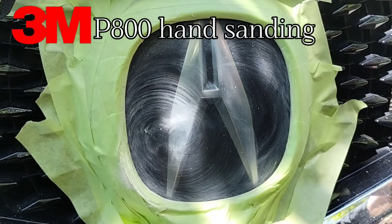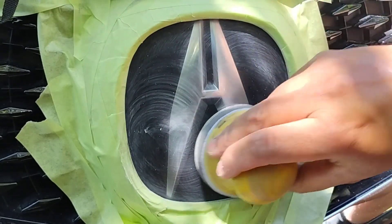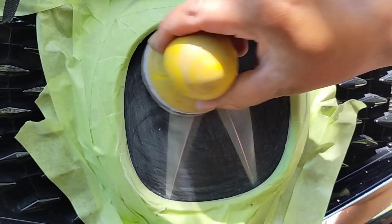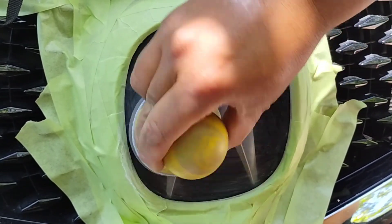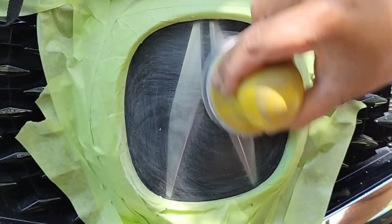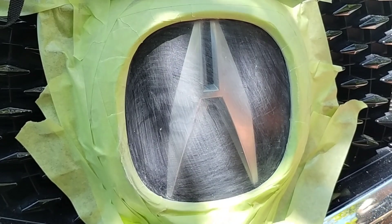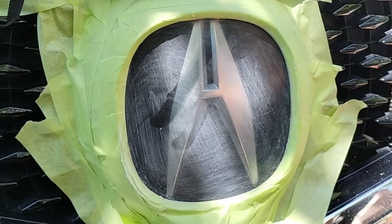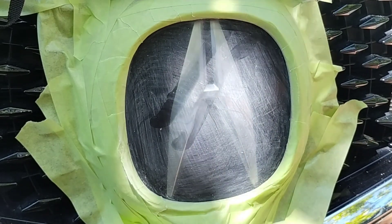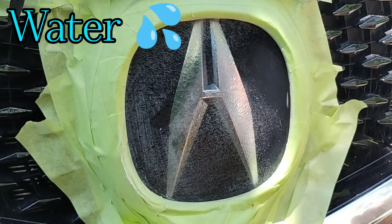As you see, I'm working the same steps as you would a headlight. You can see the white powder and the little dust picking up — it looks the same. I'm using the same process for headlight restoration as for emblem restoration. This is a new trend that can be found in many vehicles such as Lexus, Toyotas, Fords, Scions, Subarus, Hondas, Acuras, and a couple more to be exact.